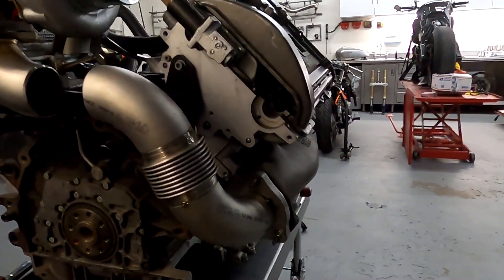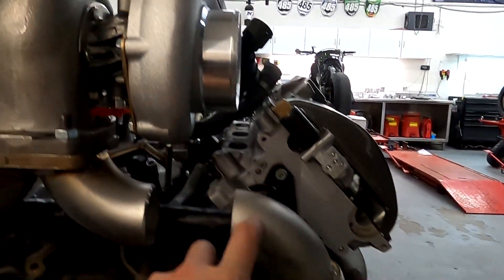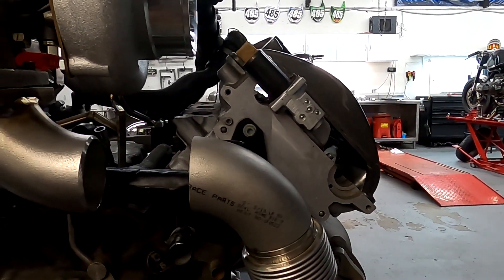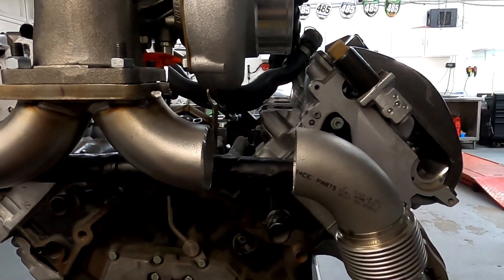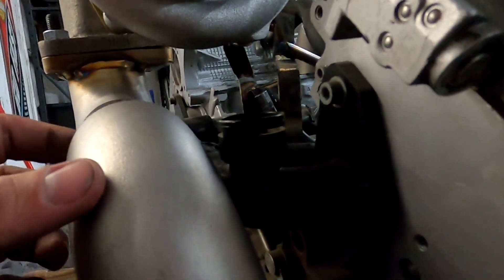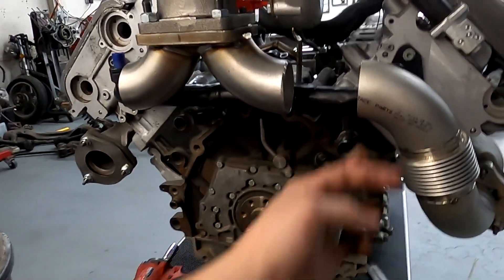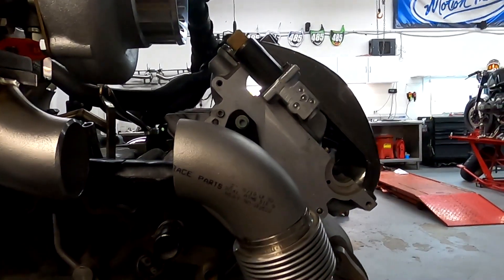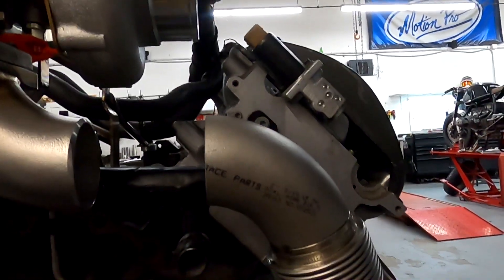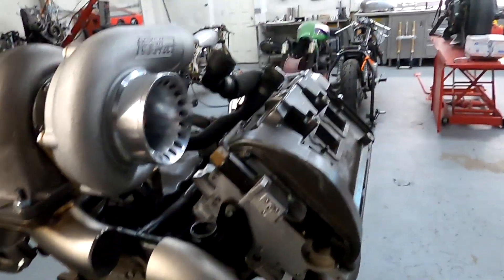This is the passenger side all mocked up. I'm probably going to break this bend back off and slightly adjust it — it's pretty much dead perfect. I want to move it over just a little bit so the piece of straight pipe will fit exactly in there, but this gives me a pretty good idea of where it needs to be. I need to brush the material before I weld it, so that's probably about as far as I'm going to go in this video.